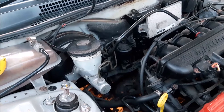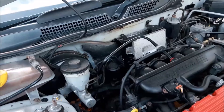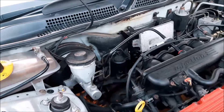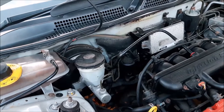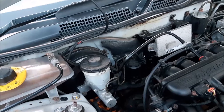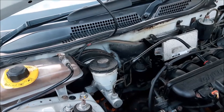This is where the brake fluid goes in, on top of the master cylinder on the Rover 45s. We prefer to do it the old-fashioned way — there are a lot of kits out there, one-person setups where you put brake fluid in a container and use air from a tire to push it through. We've got one of those, but with two of us it's easier and more reliable to have one person by the bleed nipple and the other pumping the brake pedal. We find you only ever get a really good brake pedal doing it this way.